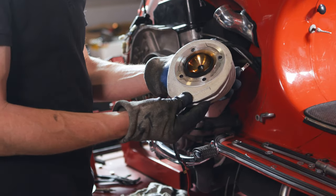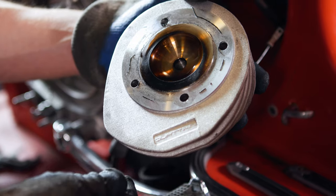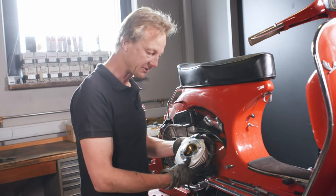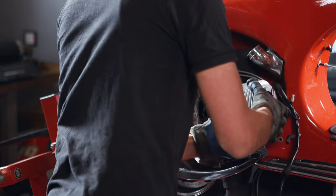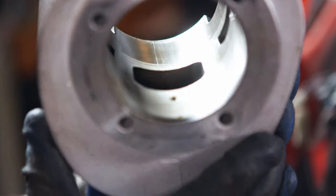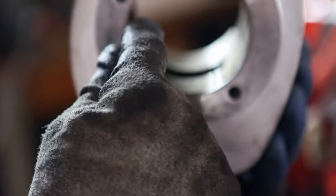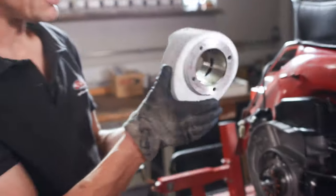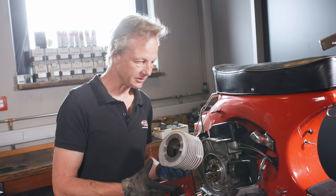It's nice how brown it is — looks cool. We can see that there were no impacts. It is also not grey, which would be a sign of overheating. You can see that the cylinder is still in good condition and has not jammed. We can see that it has minimal friction marks, which can often be seen on the exhaust side, but it looks quite good. It's normal that you can still see the cross grinding after 1,000 km.